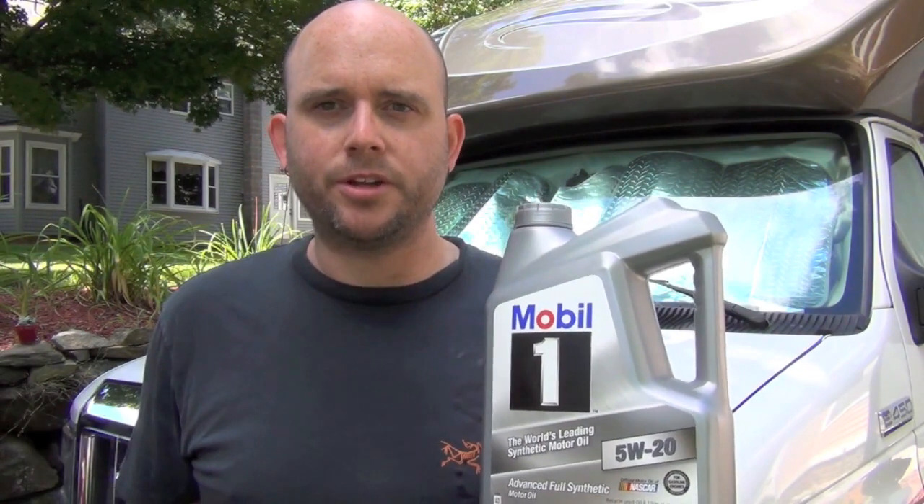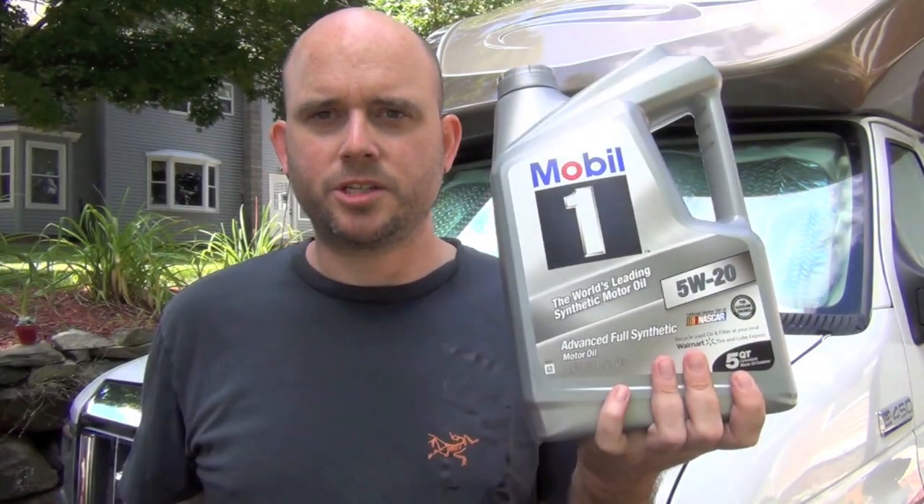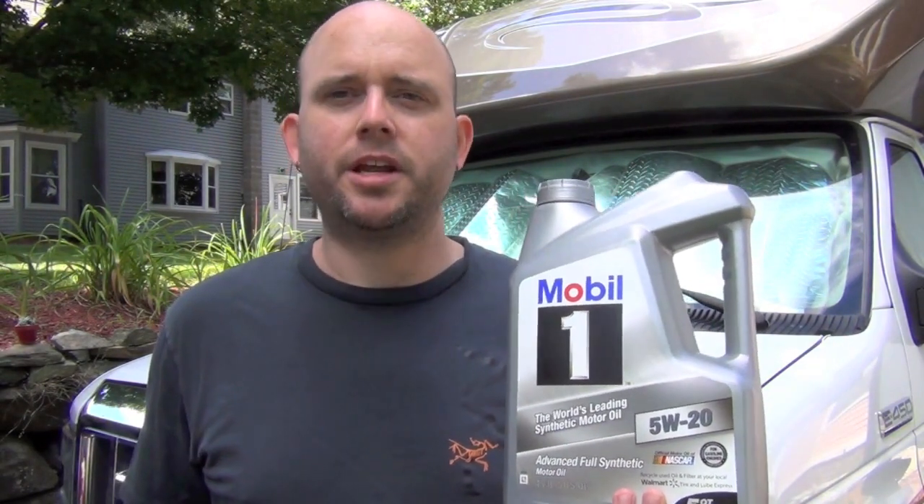The argument is that thinner oil may cause more engine wear over time, so even though it gives slightly better fuel economy when the car is new, you might see worse economy after 100,000 miles as parts wear. I'd rather just do what the manufacturer recommends — Ford recommends 5W-20, so that's what I'll use. Running 10W-30 would probably be fine too, but the Motorcraft oil Ford recommends is only about 50 cents to a dollar cheaper per quart and is semi-synthetic, whereas this Mobil 1 is fully synthetic.